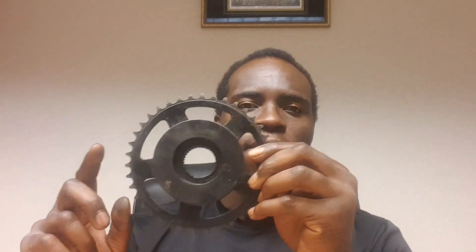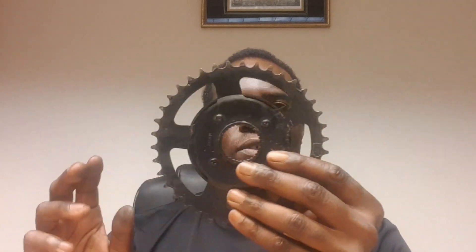I'm thankful I've been able to remove this — technically this isn't the M620's chainring, it's an M420's, but it was on the Dengfu E22 just so I could get a chainring compatible with 11-speed, even though I'm running a 12-speed chain. It was the closest thing I could find. But now with the 104 BCD adapter I can actually put on an 11 or 12-speed optimized chainring which will complement my current setup.